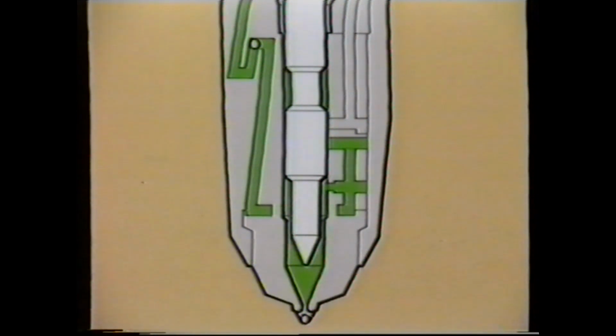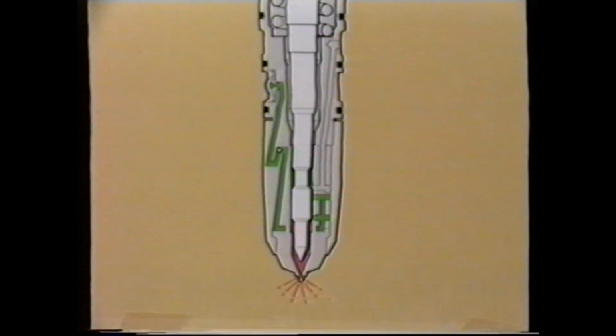In extreme cases, damage to the injector cup and camshaft may result because the crush imposed on the injector will be in excess of the designed limit. Therefore, care must be taken during the setting procedures.